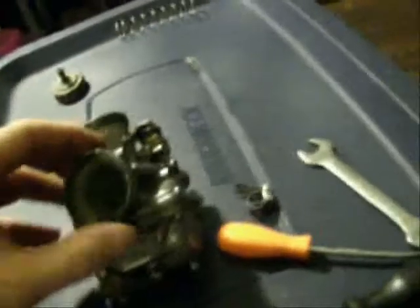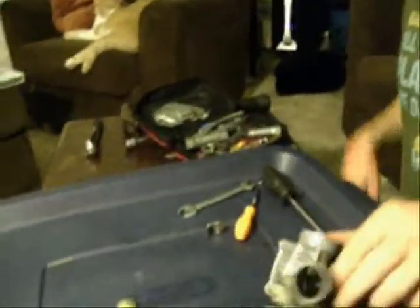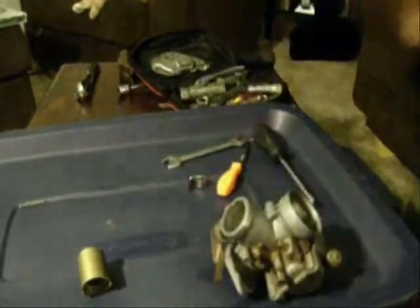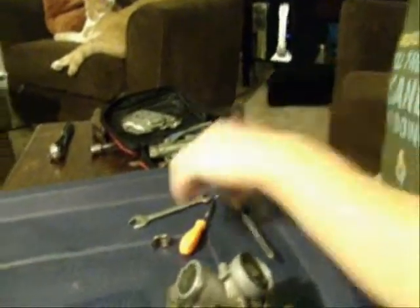And one thing I wanted to add about the carburetors is as you're putting everything together, you'll notice it's really simple. And when you're cleaning those out, make sure that as the carburetor cleaner is coming through all of the little ports, all those ports on the carb are really clean, because any one of those ports being off is going to really affect your mixture. All right, so now it's ready to go back to the bike. Not quite. Yeah. So you have to take it back to the bike.